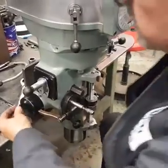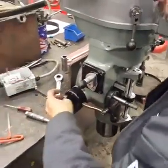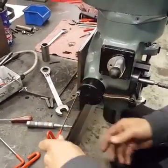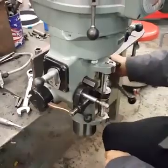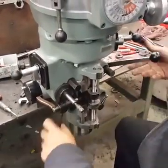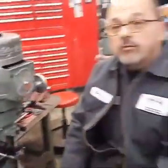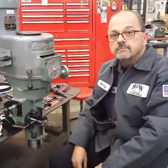So it was that simple. What you do at that point is put a set screw in here and beat a quarter-twenty nut there because you just basically want to lock it in position. Get your wrench and lock it down. One more test — and that is it. Voila! Now that's a fully operational clutch working for you and it didn't cost you anything but a set screw.